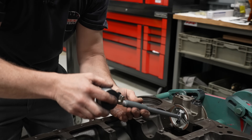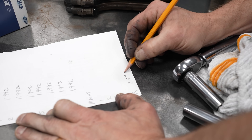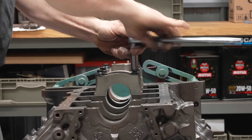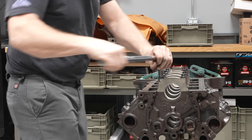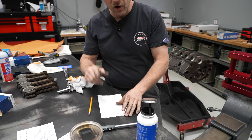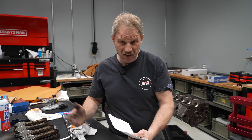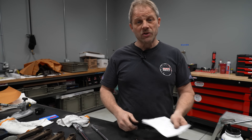So that main measures at 2.2925. Now here's my RockAuto.com tip of the day: measure every one of them. Don't assume that because you bought bearings from the same company they're all marked correctly or that measurements are the same, because they might not be — stuff happens. And to go along with that, write everything down so you have a permanent record. Now all I've got to do is get these numbers off to Doug so we can get the crankshaft cut.